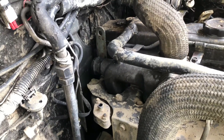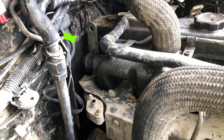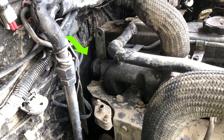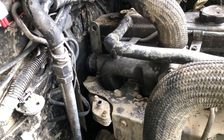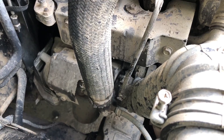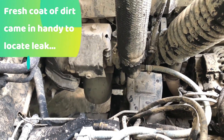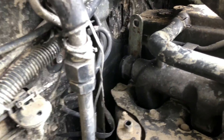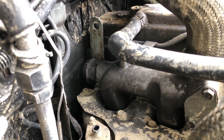I'm gonna try to remove the intake manifold overboost valve which is right there, and I believe that's what's losing my boost pressure. If it's not that then it's definitely the wastegate, but I don't see any black smoke around the wastegate. It looks much darker around the overboost valve so I'm suspecting that's probably the problem.